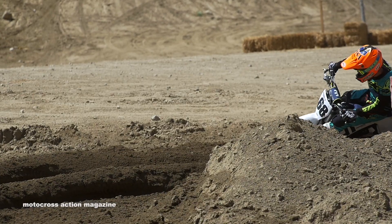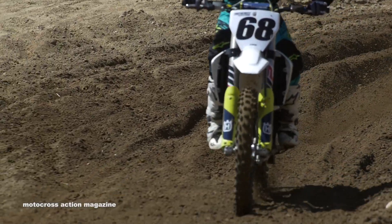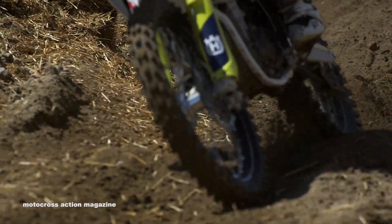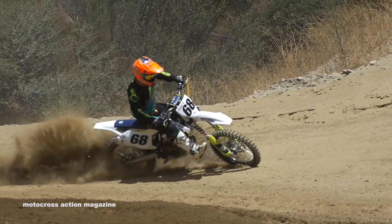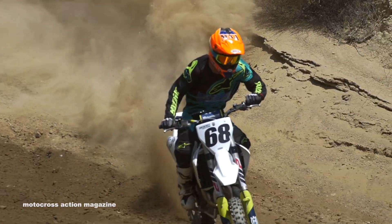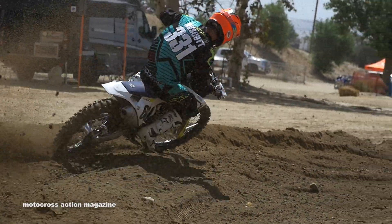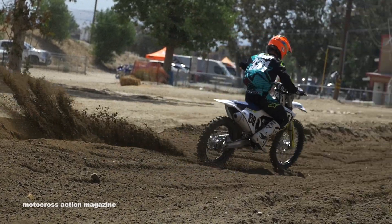Two major changes on the bike are obviously the suspension and the battery. It's 105 degrees out here at Glen Helen, so we can't really tell if it starts better in cold weather. As far as the suspension, last year it was plush but got pretty far down in the stroke and got harsh. Now they've made the initial stroke a little stiffer so it rides up higher — it was actually more plush, and coming into corners it didn't dive. Everyone from beginner to novice to pro liked the setup a lot better. The shock is revalved a little differently, but the change was small enough that normal riders may not feel a big difference, at least on day one.